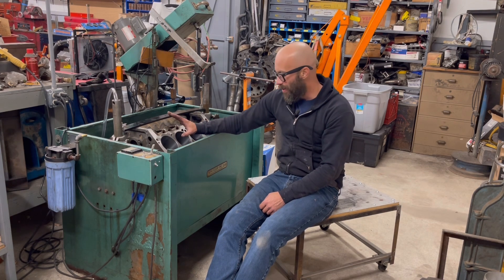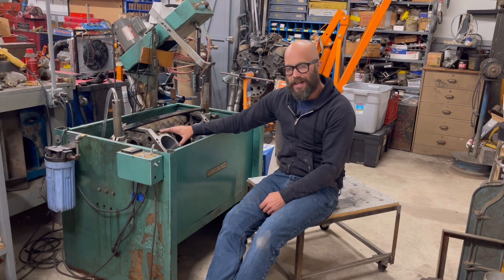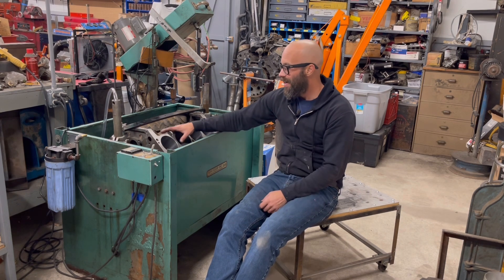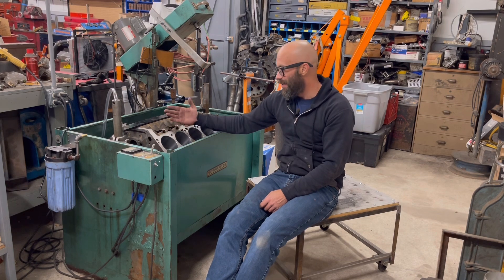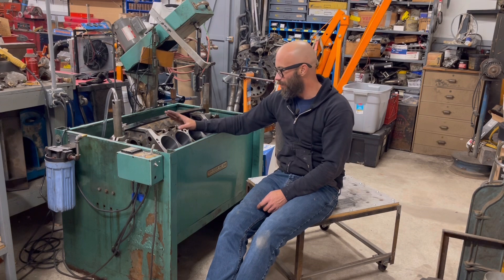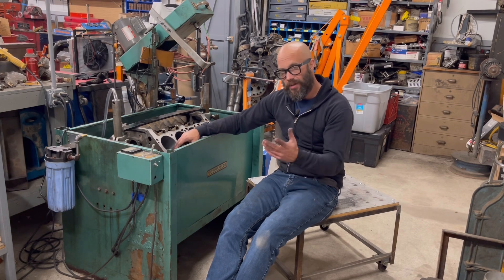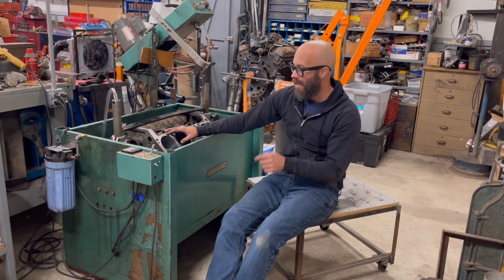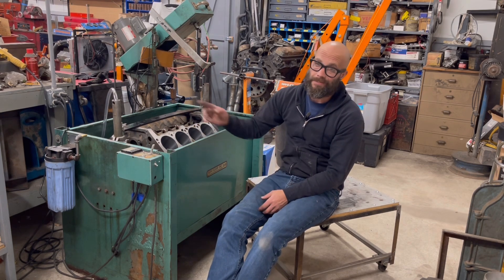You want proper torque readings. You want proper torque specs. You've got a lot of time, a lot of money — a really good investment going into your engine build. You might as well do it right. It takes a couple extra hours to do all that work, but it really does pay off. The small things are a good thing. Next step we've got to do with this: we need to finish hone it. We've machined it, it's bored, the deck's been surfaced, everything's cleaned out, threads are chased. Next video we're going to finish hone it and put the correct cross hatching in per the rings. Then it goes on the hot tank, we'll get cam bearings slammed in it, freeze plugs in, and then it's ready to assemble.